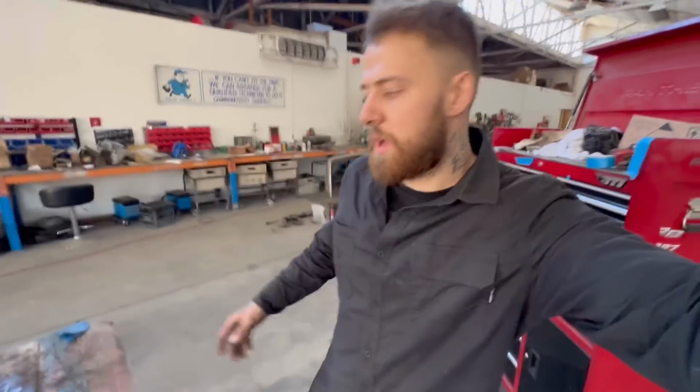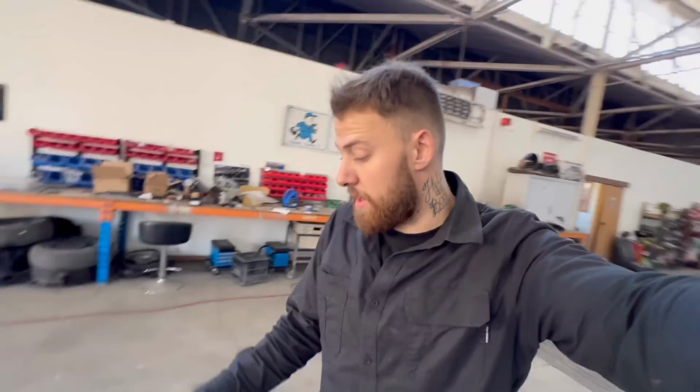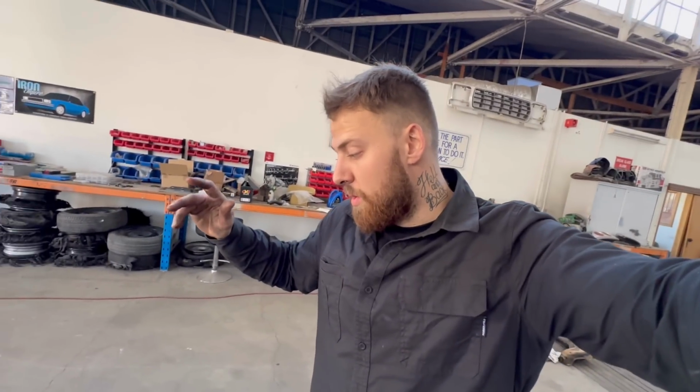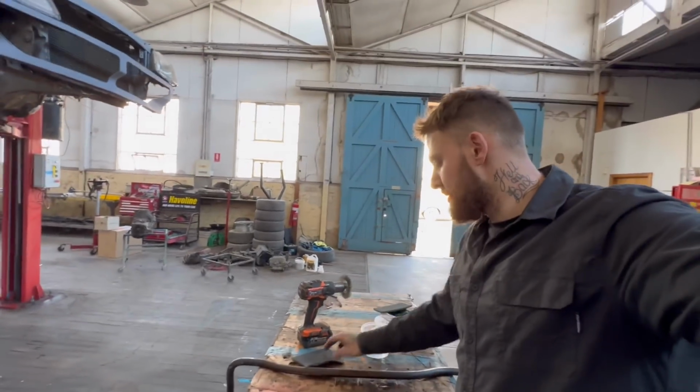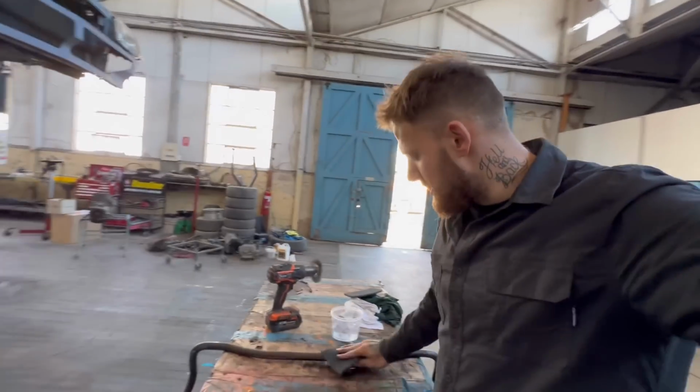All right, quick tip. Sometimes some parts are a little bit dicky to wire wheel and just difficult, doesn't matter what the thing may be. What I like to do is a bit of gun wash, a bit of Scotchbrite, go over it. For a suspension component that you're pretty much gonna take back to bare metal before paint anyway, it's not gonna harm it, you know what I mean? And it gets all the grit and grime off because the gun wash is just like a really strong thinner. So, boom, there you go.